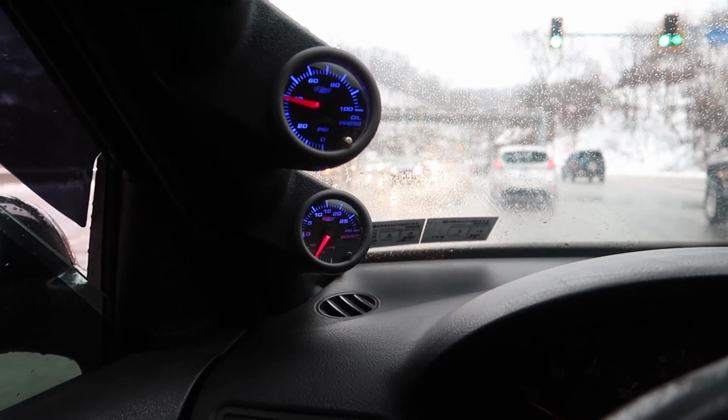And something cool that Glowshift offers is they sell a sandwich plate adapter, so you can screw the sandwich plate adapter to where your oil filter goes and then thread your oil filter into that. And then the sandwich plate adapter has a bunch of holes on it that you can hook Glowshift gauges into. So when I go and get the oil temperature gauge, I can literally thread it right in. There's no tapping, there's no drilling, there's nothing. It's like a $15 part, and it doesn't leak, and it works seamlessly. So oil pressure is something very nice that all cars should have, but mine didn't, so I went ahead and made it have oil pressure.